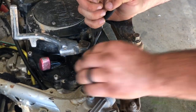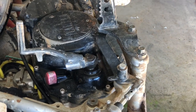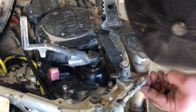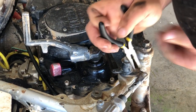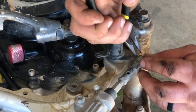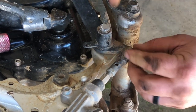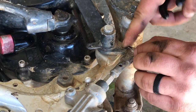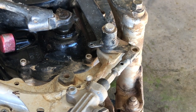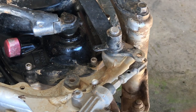Be careful with that spring because it will shoot back at you. Now you have a little makeshift cotter pin over here — remove that. It holds the pin to the rear brake master. Then that goes, it falls out just like that. And then this can come out.